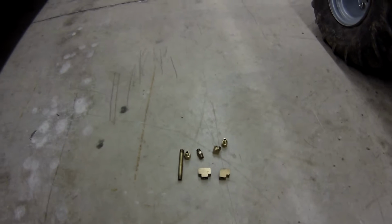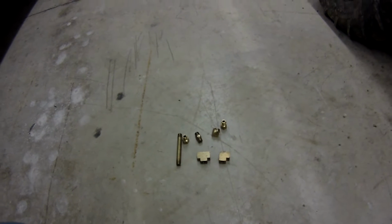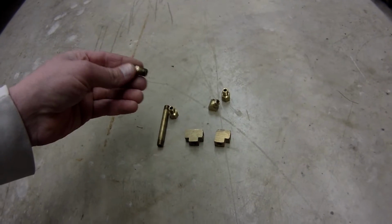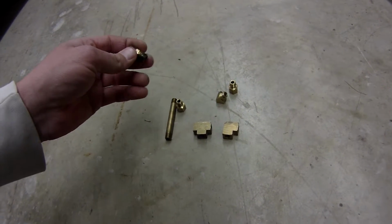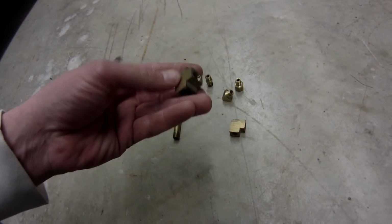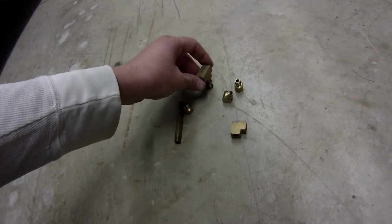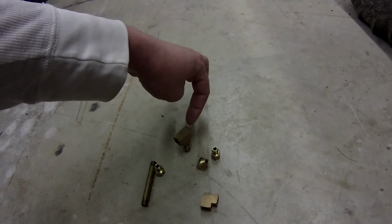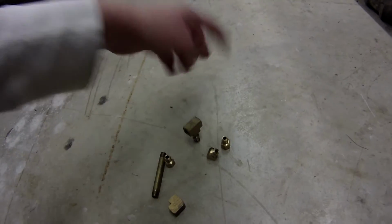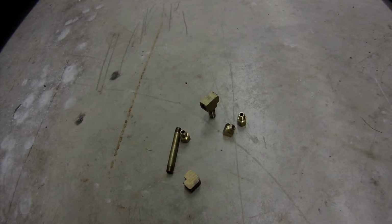All right, so after you pick out your gauge, which I wanted mine to match, so I went with the Amega series that are pretty much like the factory Steiner. I got my sending unit. I'm going to remove the switch that's in there, the low oil pressure sensor switch, and I'm going to put this in there, and I'm getting an all female T, and then this is going to screw into the top of the block of the engine. Then from there I'm going to mount. You could go with the 90 and just put your oil pressure, but I figured I got room. I'm going to hook the low oil pressure switch up too. I figured I'd still like to have it just in case the gauge or something would go bad.